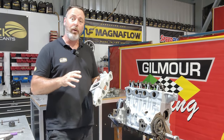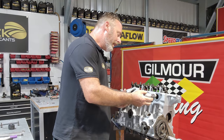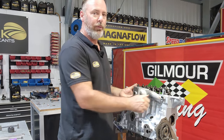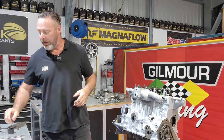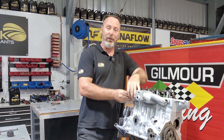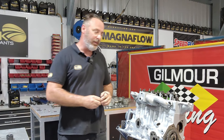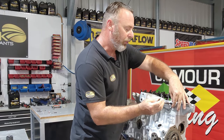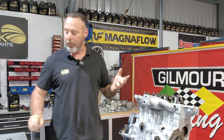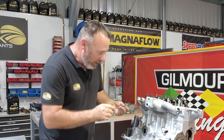And the last one's done. I've used my purple marker to put a little mark on the adjusting nut of each one I've done so I don't lose where I'm at. Using that method you still get it done in two full rotations - it's just a little bit easier than trying to count cylinders and figure out where the piston's at. Now the intake manifold can go on. It's port matched to the head, it locates via some dowels, and it's a really nice piece. We would go through and buy 15 or 20 different castings to get the best cylinder head and the best intake manifold. This intake manifold has maybe only done dyno time - it's had the top machined for clearance for the throttle shaft and ended up in the parts bin.